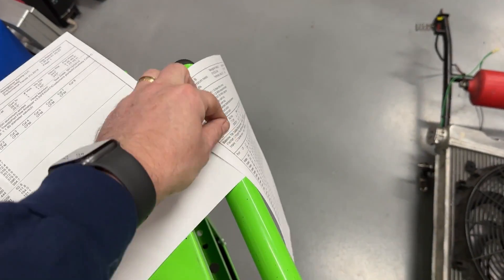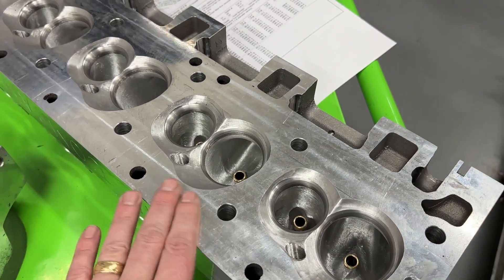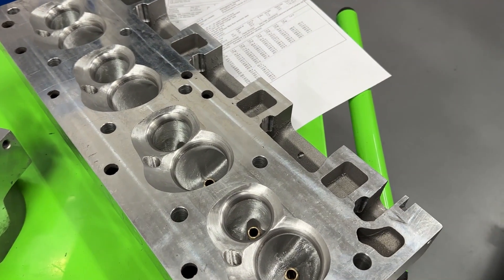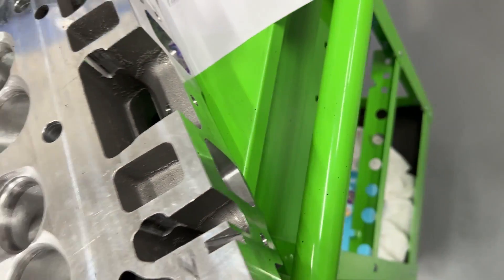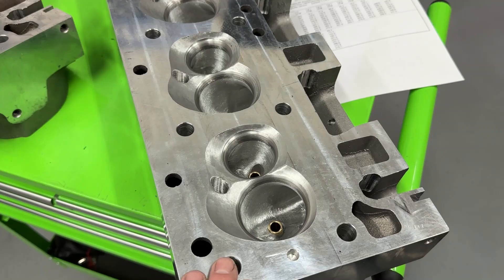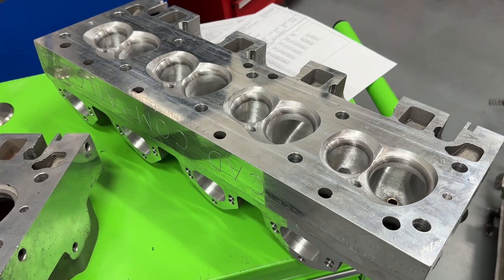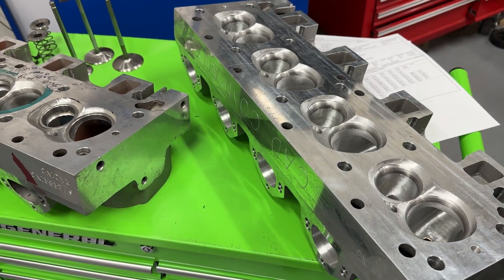I'm really curious because Courtney also has a ported intake — I ported an intake too, and Courtney's got that. We'll actually have dyno numbers on this — I don't know how soon because he's a very busy man and I've taken forever on these. He'll have some dyno numbers to see how much power it picks up. There's still a long ways to go. He said he's working on another casting where they'll file the core so the runners raise up even more, giving more material so I can raise the whole runner — a more raised runner. These are about 11 degrees — a really flat valve angle. Very nice head. Cadillac guys are extremely lucky to have this, to have anything aluminum really. This is a good head and should make some pretty good power. Thanks for watching something different. Remember, I'm no Superman. You guys take care.